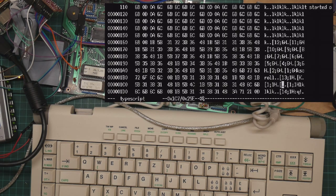So what you're looking at here is a hex dump of VI doing its scroll up. And here, these three bytes, you can see where the cursor is flashing, is a CSIL sequence, which is insert lines. So this is doing something wrong. It's somehow in the wrong state when it processes the escape following, resulting in this position code being printed. So we know this is going through CSIL with no parameters.